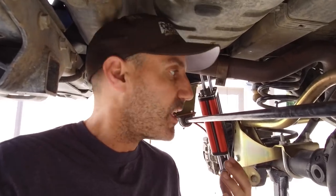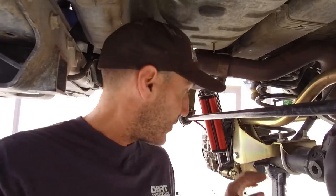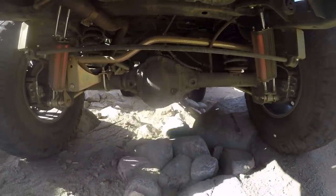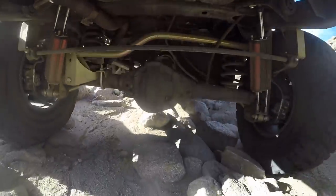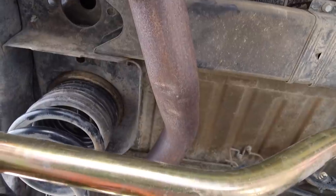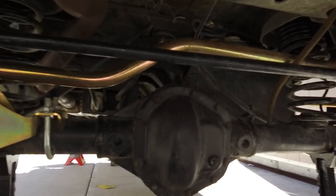Before we get all the tires back on and the Jeep back on the ground, I want to share a little bit about the ongoing upkeep and continual tuning you'll always be doing with your rigs. This Metal Cloak shock — you might have noticed in my last video — was actually sitting a little bit low in its travel. After looking at it and trying to analyze why, there was no blown seal and no oil leaking, so I looked underneath. Since I might have accidentally jumped this thing a few times in the last few videos, it actually bottomed out hard — you can tell from the witness marks on the exhaust pipe — and that would explain why it released some of the nitrogen.